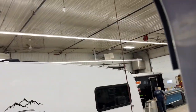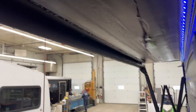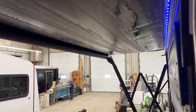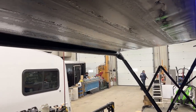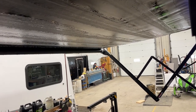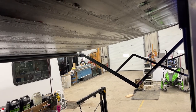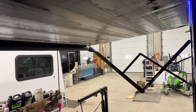For your awning, press and hold Extend and that awning swings way out. Just watch that door is at about 90 degrees. Once that awning is fully extended you'll see a little black flap coming out as well as the gray metal tube. Once you see those, stop — if you keep extending it can actually wind itself up backwards, in which case the fabric will be underneath the tube, allowing it to hold water and accelerating the growth of mold and mildew. The flap should come down there — it's just a little bit sticky right now.